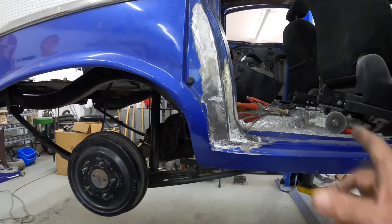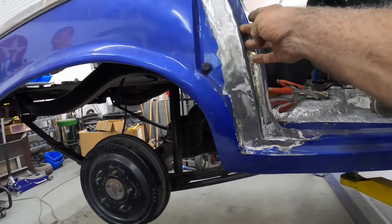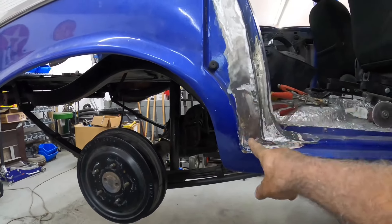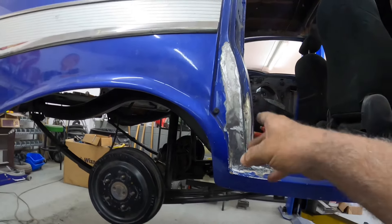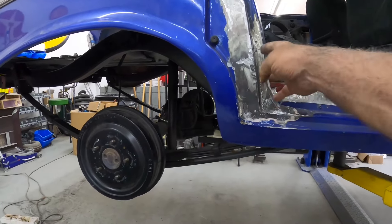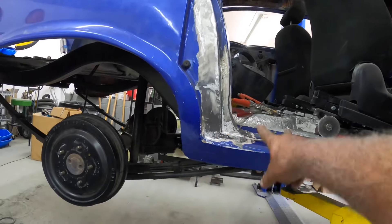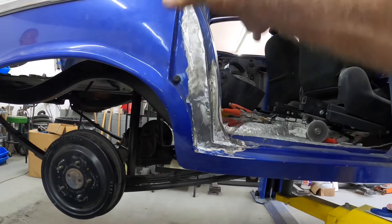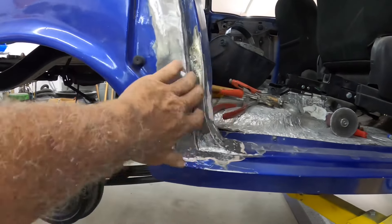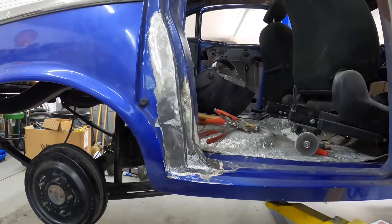This section's pretty much done. I made this section from here down - and made this section here. There's also a section on the inside. That area all had rust - this wasn't even there, it was just full of rust. That's pretty good now. Obviously it requires some sort of filler - I'm going to blend all this back out, put some filler there and make it look good. It's all steel now, no rust there anymore.